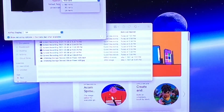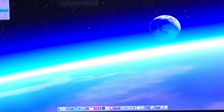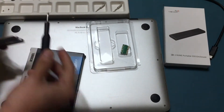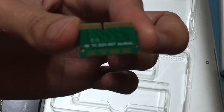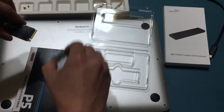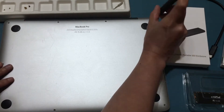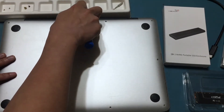You can now go ahead and install the 1TB SSD into your 13-inch MacBook Pro. To do so, remove the 1TB SSD from the enclosure and insert the adapter so you can install it into the MacBook Pro. Using the P5 Pentalobe screwdriver, remove the 10 screws on the lower case of the machine in order to access the SSD.